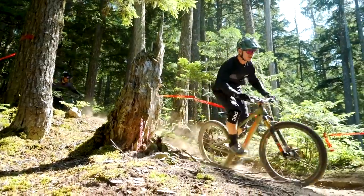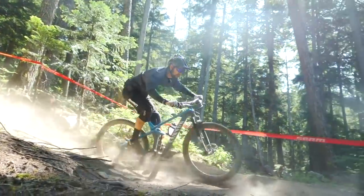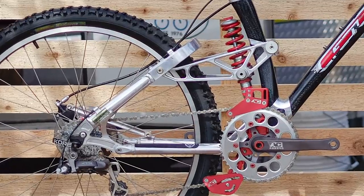The opposite is brake squat, where as you hit the rear brake it actually digs in and the bike squats down. Slightly maintaining geometry, this can be used when your fork's diving — under braking you can have rear squat. That's a good thing; you can actually pull the back end into the terrain. Due to the amount of different suspension configurations and where people were mounting their brakes, there were just so many different feelings on the rear suspension. Companies like GT with the Lobo had an almost floating brake mount at the rear to isolate their brake from the suspension feel.